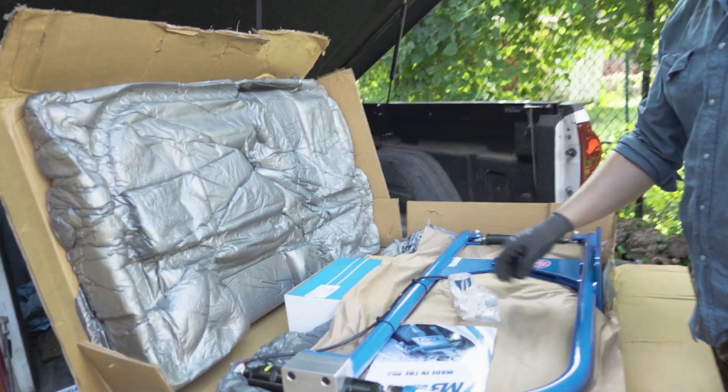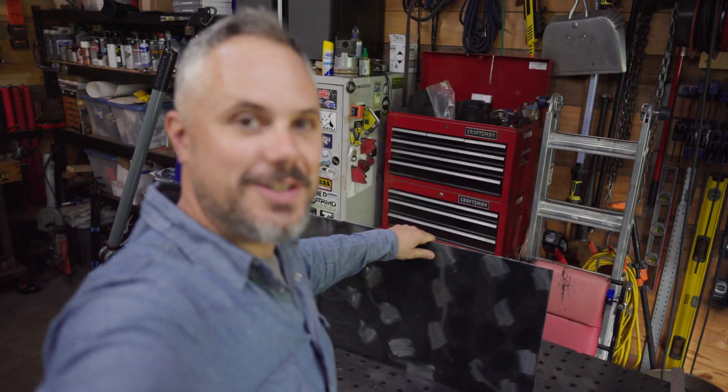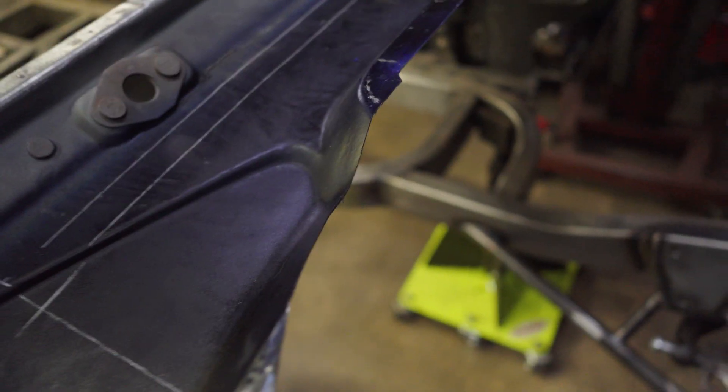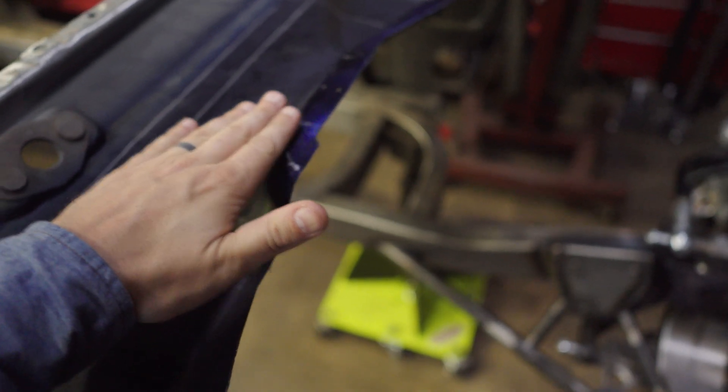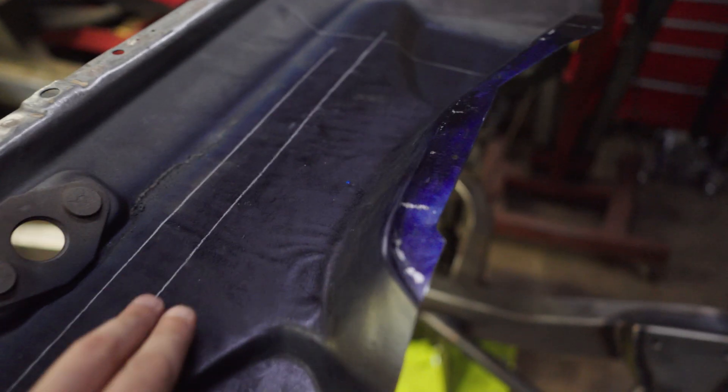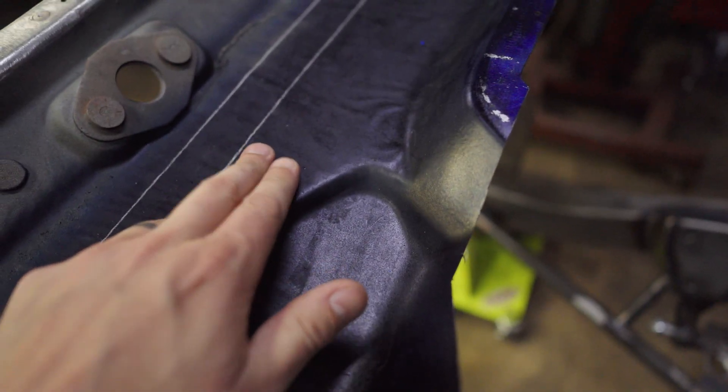I've got to build this cowl to give a little bit of clearance for where the engine is going to sit, and create a bump in the cowl. 18 gauge is a little bit thick for this, although really structural, so I favor something more like 19 or 20. 19 is hard to find — it's very automotive common but hard to find at the metal shop, unless you happen to have hung on to a piece from a Chevy hood. I've been hanging on to two pieces from where I did the louvers on my Suburban for just this special occasion. I want to go from this plane all the way backwards and then taper down, leaving enough room for the windshield wiper to poke up and through, kind of following this shape here — pushed out all the way to the corners — so that it still has a little bit of a factory vibe to it.